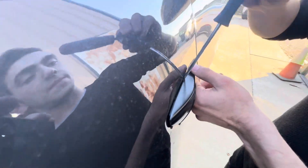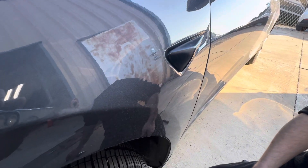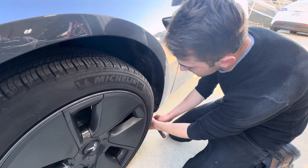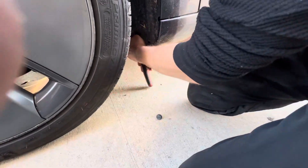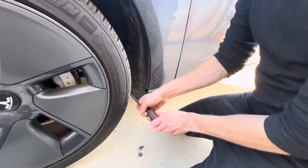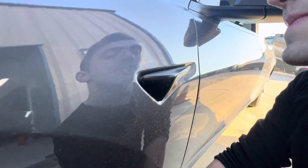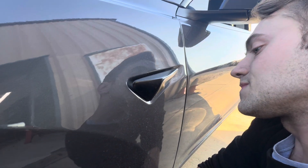We're trying to show you with something a normal person would have. Now it's time to get them unplugged — we're going to go in through the wheel liner to get to the back side. Just pull out these little tabs and pull that wheel liner out so you can get your arm in there, then we're going to hit those tabs on the back side.